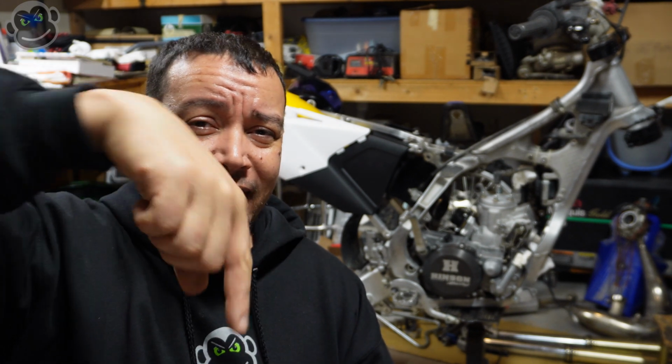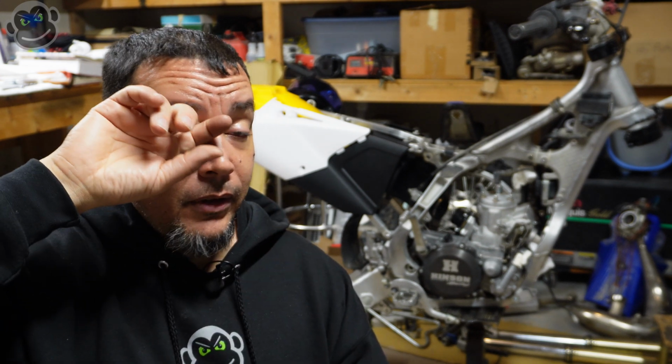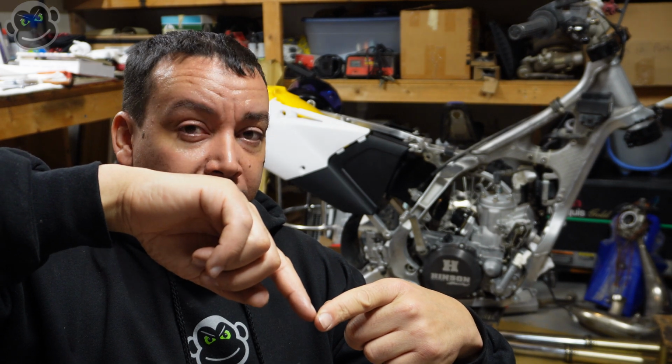They weren't that good. The first one was where they tell you to drive a screwdriver in at like a 45-degree angle from the side, and then pry it out and dig it out. Well, dude, I did that for like 5-10 minutes and was just not having any luck at all. So what I ended up doing was just taking it out from the center, and I think I talked about that in the video. I recorded the clip, but basically there's two pieces, they meet in the middle. Take a screwdriver and pry them apart from each other from the center. There's just gonna be a tiny little gap, and then just take some needle nose pliers and grab it and pull it out.